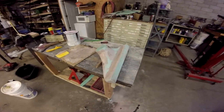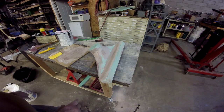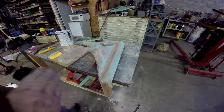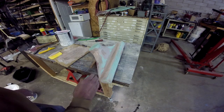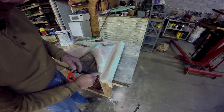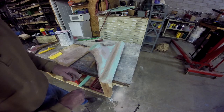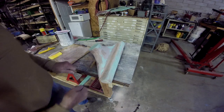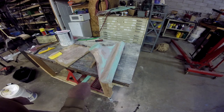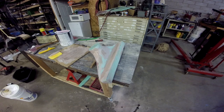There it is. What I kind of learned was the trick is to keep working it like you would concrete when finishing it. As the body filler got a little harder, it was easier to smooth it out and get a better transition. It kept damming up thick on the sides, and going back with a putty knife to scrape it off would leave a big ridge. I found that if you keep working it with the forming tool — which is a hose — as it hardens up, the transition kept getting smoother and smoother. Just a little lesson learned there.